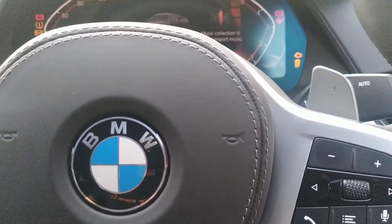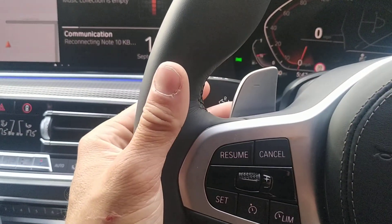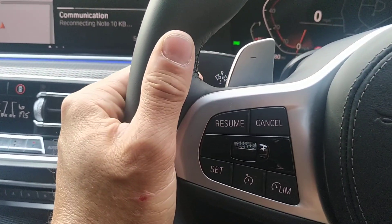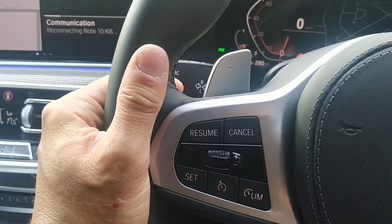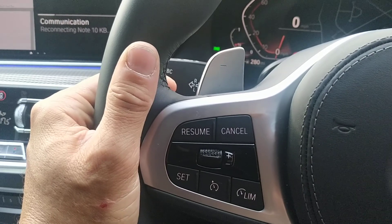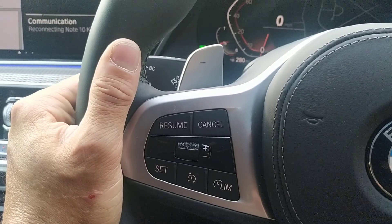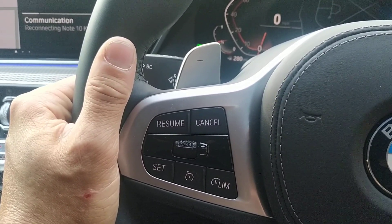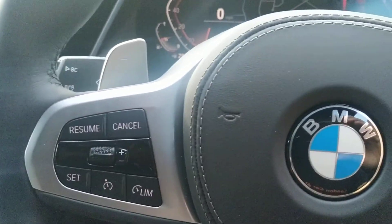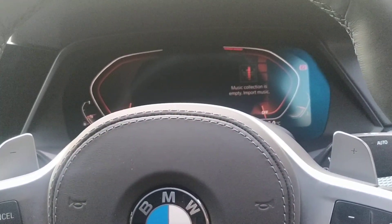Get five bleeps and now we're going to change it to something like this: one, two, three — receive your melody. Again, one, two, three — receive your melody. And this is the new code. I'll give it about 10 seconds and then I'll turn the ignition on, start the vehicle, and try the new disarm procedure.